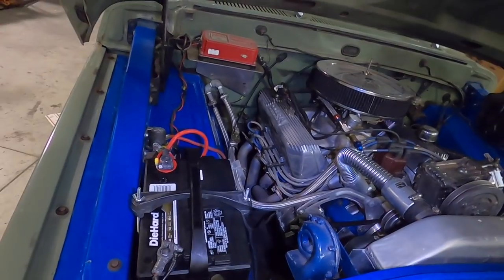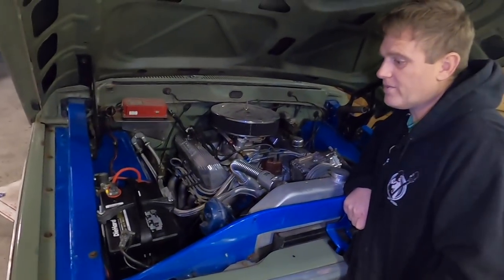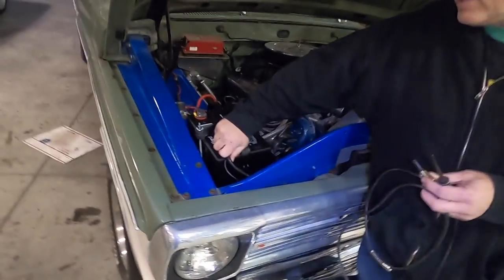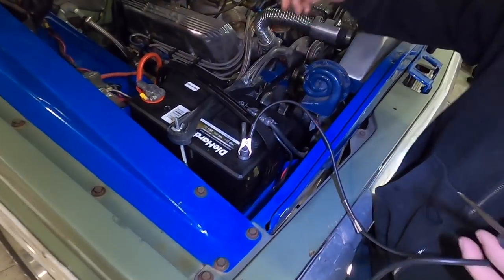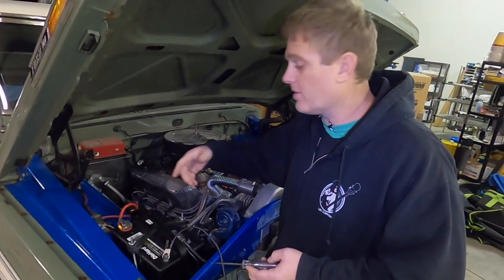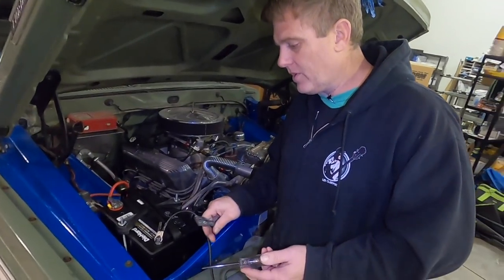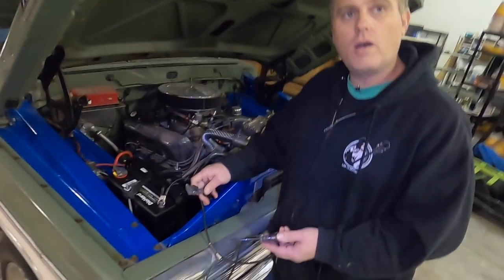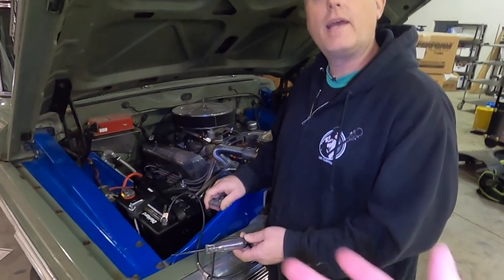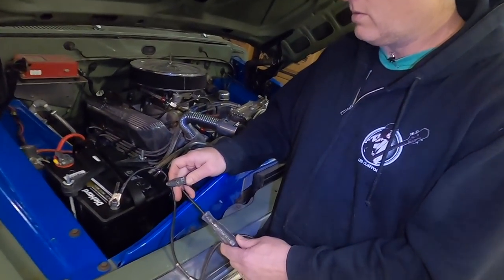Another problem I know about is I just replaced the battery but I seem to have a drain on the system — when I leave the battery plugged in it might be dead after a couple days. We can check for a draw with a test light. All you do is disconnect one terminal. If there's a draw — meaning something is pulling power even when everything's off — the flow of electricity will actually light the test light up even with the terminal unplugged.